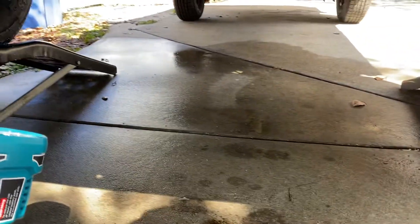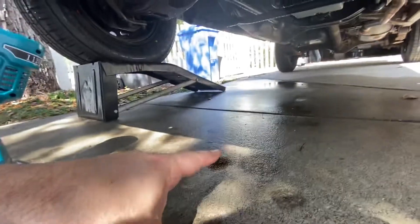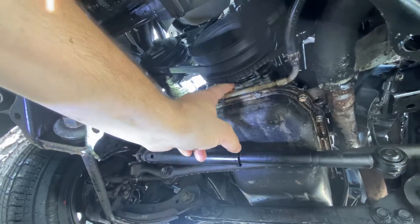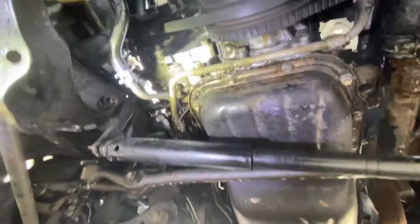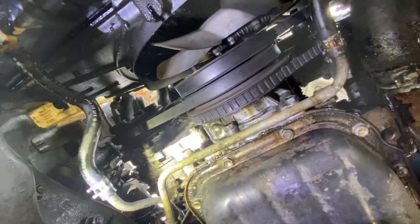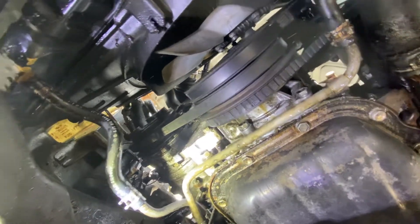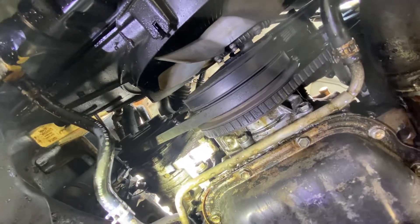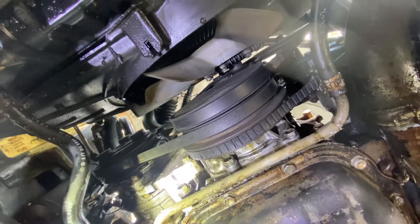So in this engine's case, if you look where the drip is here on the ground and look straight up, you could see right there engine oil coming at it here. The actual oil will start to accumulate and push itself together to make it darker than the water. So if you trace it back up there, you can see that it's leaking from that front, that little front seal.